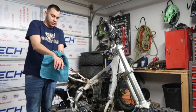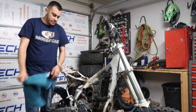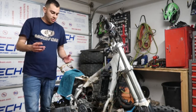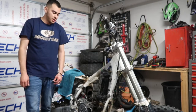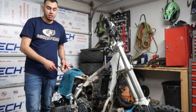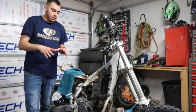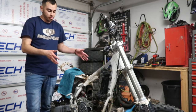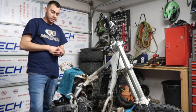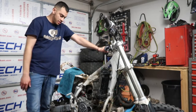Alright, you guys, so great first day. It's kind of what I expected, I guess, that the crank was going to be bad. The bearing on the connecting rod is just toast. It's pretty much welded and obliterated in some pieces. So I'm going to look for a new one. Stay tuned for probably me splitting the cases on this thing and then figuring out if there's anything else I need, obviously the piston. But as of right now, we definitely do need a connecting rod bearing and probably the whole crank. So we're going to go ahead and look for one. Stay tuned for the next video on this thing. I feel like we got a lot done. So not doing terrible. It'll be okay.